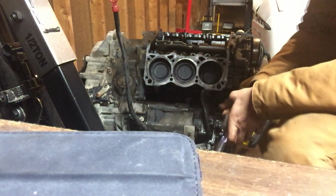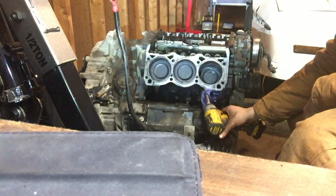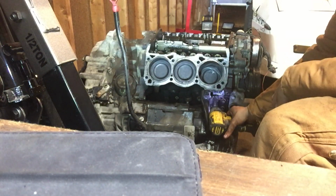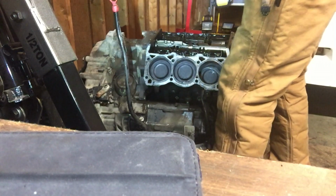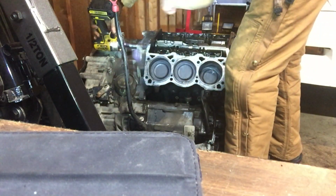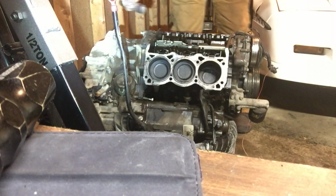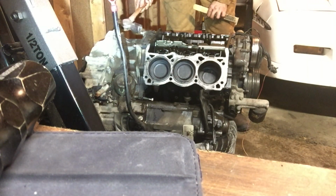Now to take the engine off the transmission. There are 2 transmission mount bolts right down here, 13 millimeters. Now get the transmission off the block. There's these 18s all over here, here, here, all around the block. So what I did, I'm going to separate the trans from the block now, is back out these bolts that hold the trans in a little bit and just tap them.